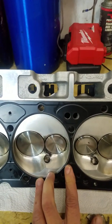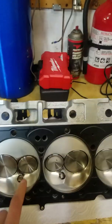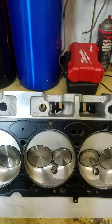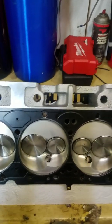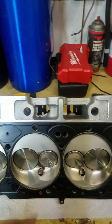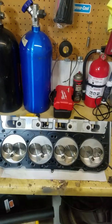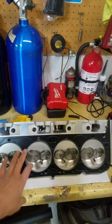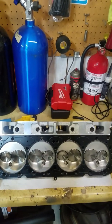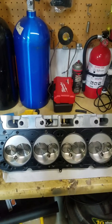Same thing on this side — it's close, but not in the chamber at all. If you use a round bore gasket, it will hang in the chamber here and here. A 4200 bore gasket will seal being a round bore, but it's not right and it's just barely sealing. If you had like a 4160 or 4165 bore gasket that was round, I don't think it would seal at all. And if it does, it's going to let loose at some point.